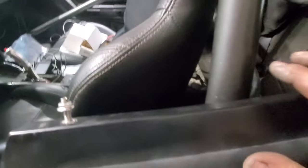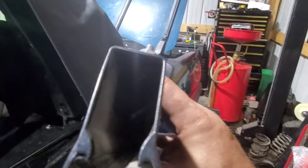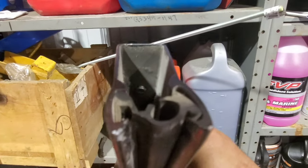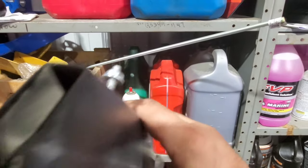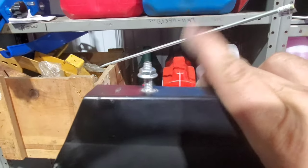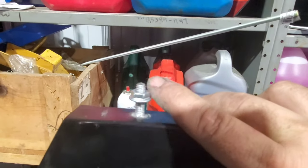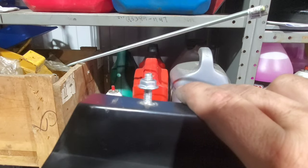This is the other side — I glued it in. Before I glued it in I was trying to tighten this, and I tightened it so much this pulled right out. Can't put a lot of torque on these. It was just barely hanging on in there and it pulled out. I had to kind of bang it back in — put the nut down on the flat side and bang it down — because it kind of mushroomed out when it pulled out. So I just got to remember: that can't have much torque or it pulls right out.